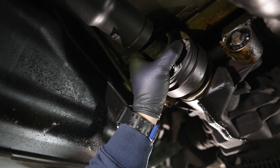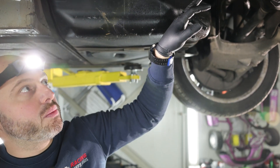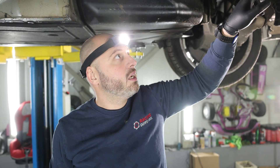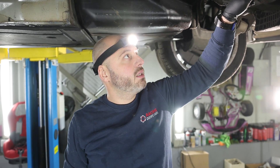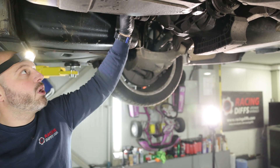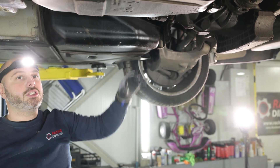This is what I was talking about — this is the free play that transferred into the pinion gear due to the complete breakdown of the bearings. You can see it right here. If you want to skip this from happening to your car, you need to take care of the free play in the left output flange to address that problem before this happens.